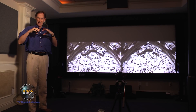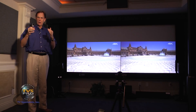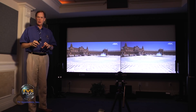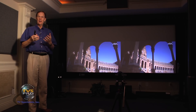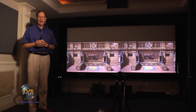After we calibrate them — by calibrate, I mean a simple calibration such as you can do at home, not using instruments but using a test pattern — we'll set the contrast level so that we don't clip any highlights and we'll set the black so we're not crushing any blacks. Once we do that, we can compare color, compare contrast, and finally compare detail to see how close the Epson 4K E-shift can come to actual 4K.